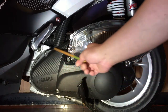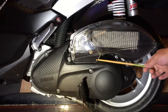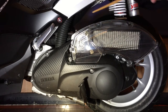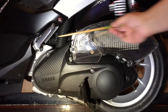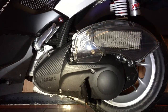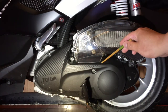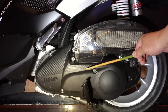This section here is a CVT cover — the CVT is there and it sucks air in from the top of this CVT. The reason Yamaha have designed it this way is because if they put it anywhere else it would have sucked in air from a more vulnerable position. For instance, if rain is coming down while you're traveling forward, rain is going to be hitting the main plate and dripping off before it gets to this section. So it's sucking air from here — a little bit of moisture may go up, but it's not directly impacting the rain. The CVT box is hot, which is why there's a cover there.